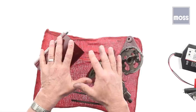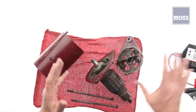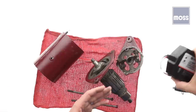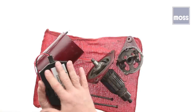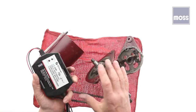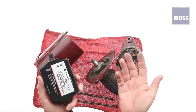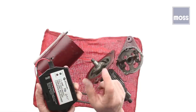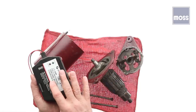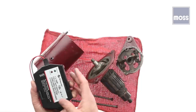So if we're going to park our classic car for periods of time, we can completely avoid the harm that a parasitic draw or natural discharge will cause by simply installing a maintenance charger in the car. Then when we go to start the car, the charging system will not have to work itself more than it was supposed to, and the battery will not be subject to a high charge. As Benjamin Franklin helped us to remember, dealing with the problem when it's small — as we can with a maintenance charger — will help us to avoid a bigger, costly, inconvenient problem later.